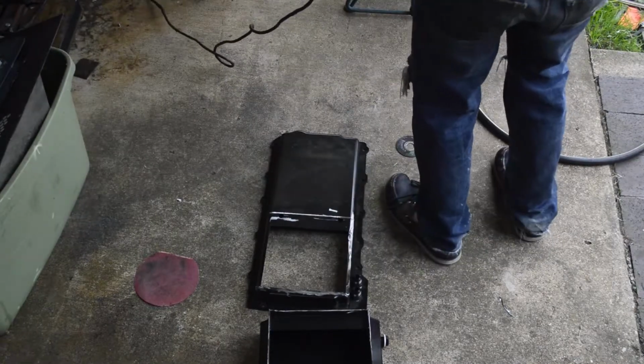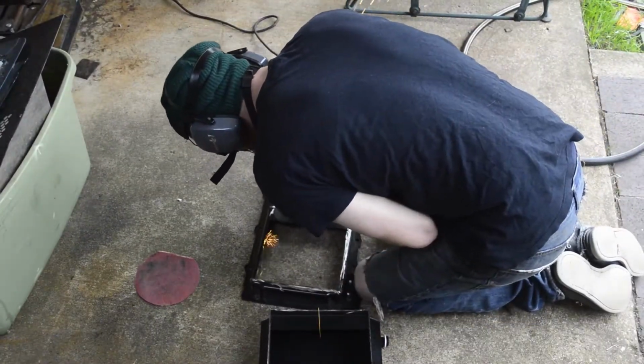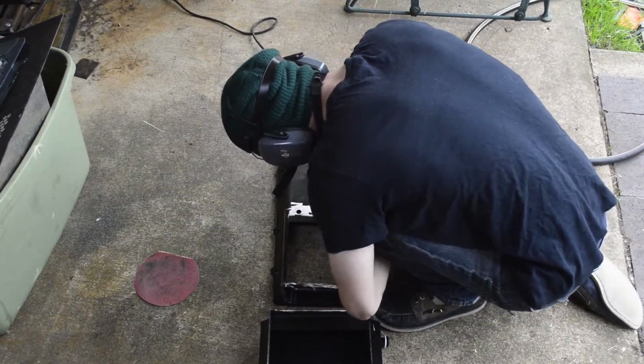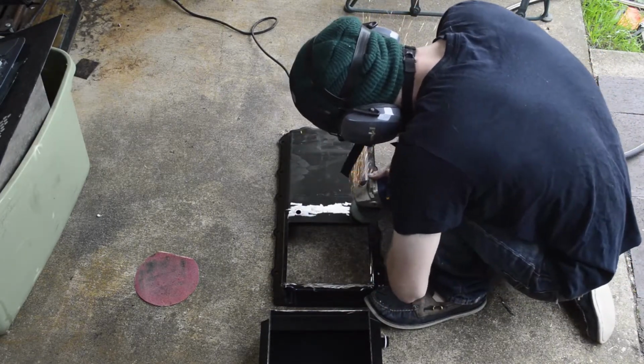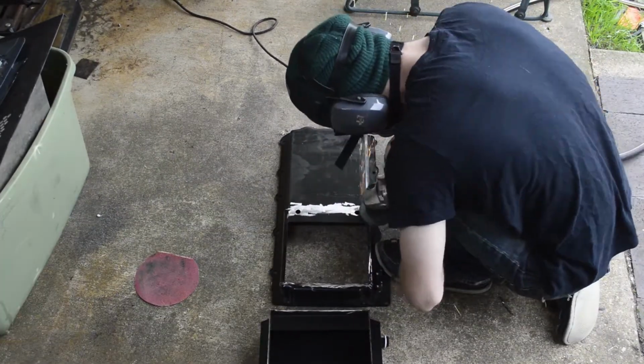Then I started to work on the oil pan for the LS4. I went ahead and cut the sump off the bottom because it was going to have to be moved about 7 inches forward in order to make room for the starter. The LS4 is normally attached to the 4T60E or the 65E, and they have provisions for mounting the starter on the side of the bell housing.